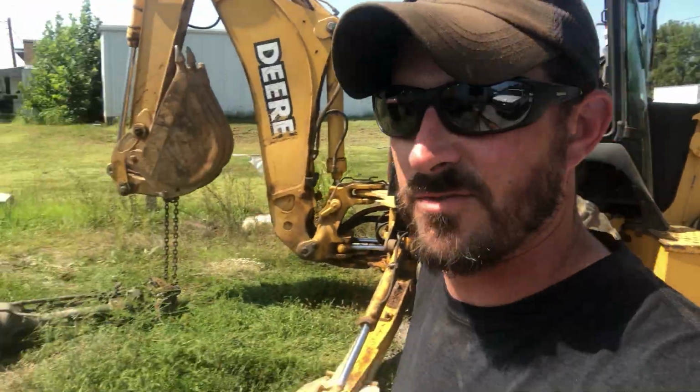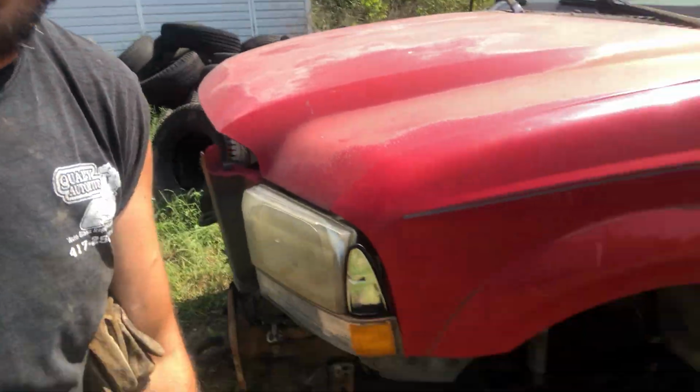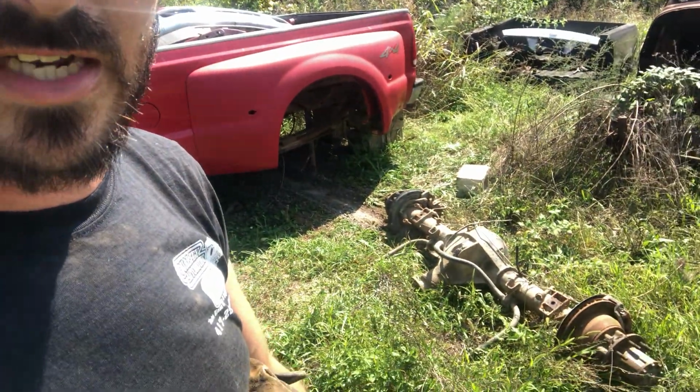All right guys, so there's my axles out. The front axle I will be putting underneath the ambulance over there. Like I say, I'm going to take the front brackets out from under the front of this truck, and hopefully I'll be able to refabricate them a little bit and put them under the van. I hope the frames are the same width, or close, so I can just unbolt them out of here, drill some holes, and bolt them back in the van.